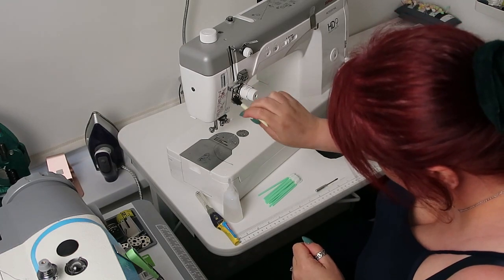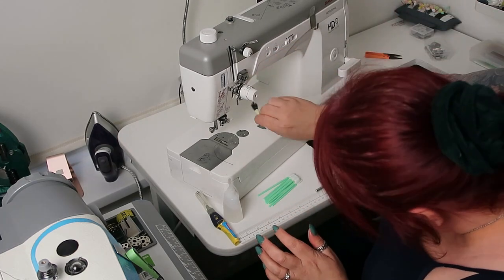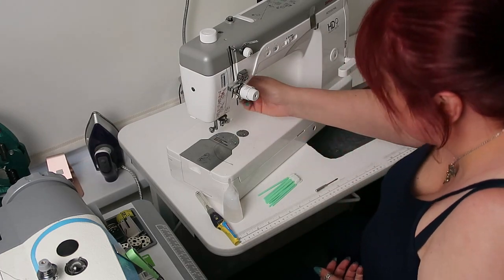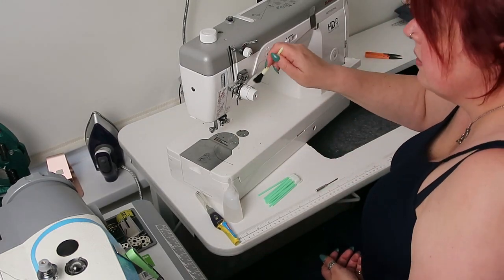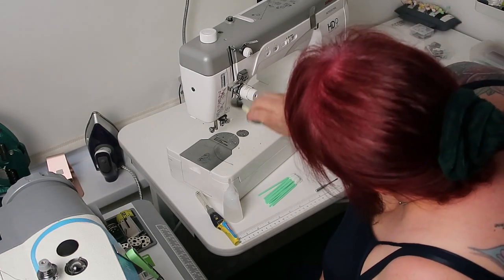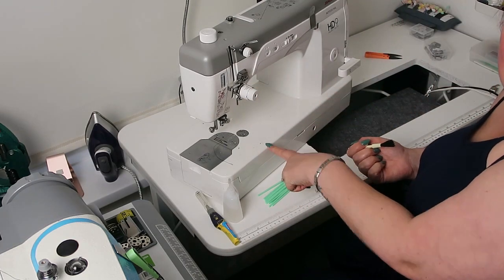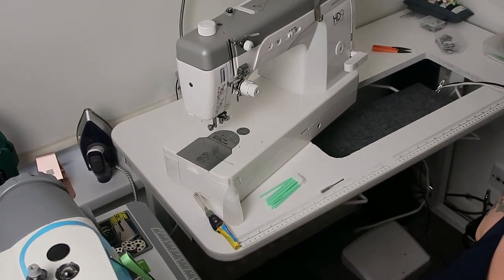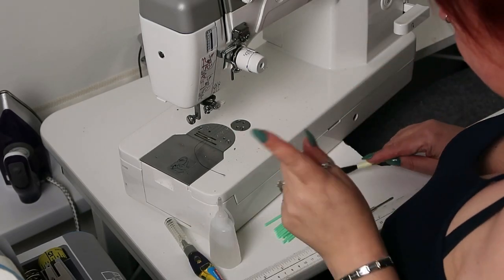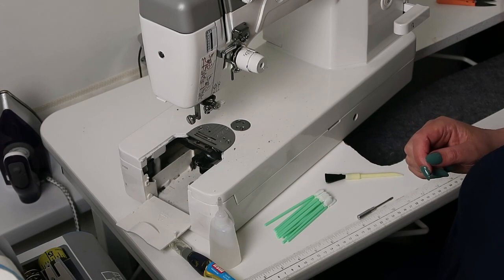Because it's quite dusty around the front, I'm just going to give all the bits that you can see on the outside a clean. I'm just going to make sure that there's no bits of thread or anything in amongst the tension discs - you can see there's actually quite a bit. I'll try and zoom in - yeah, I'll actually leave it on that because you can see it a little bit better. I'm also going to take out my bobbin.